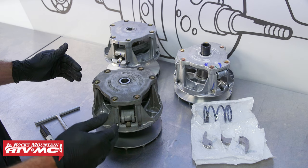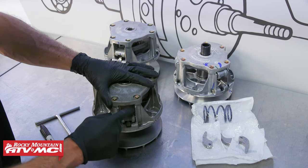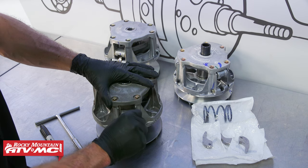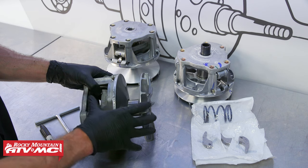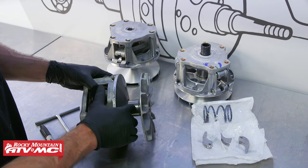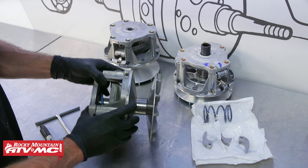For more details, refer to our video on how to inspect these clutches. But if the towers are really worn down, or if you have deep grooves in the sheaves, chances are it's going to be cheaper just to replace the whole thing. Another thing that can happen is wear to the sheave shaft, so be paying attention to those kinds of things.